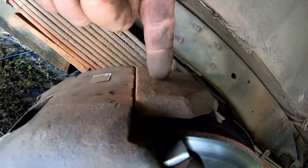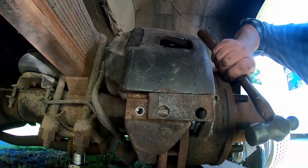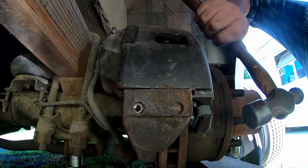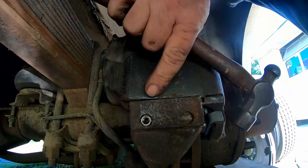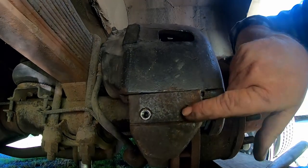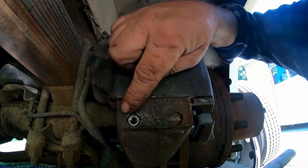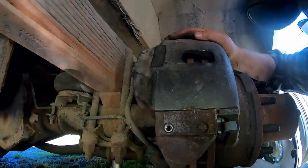The caliper sits between this piece and this lower piece — the thing slides up here, the bolt goes in right over here. You gotta tap that piece back until the bolt hole looks centered in there. It has a second hole because these are kind of universal — it's opposite on the other side so the bolt hole lines up. Once that bolt's in, the caliper can't go anywhere and the new pads are in it.